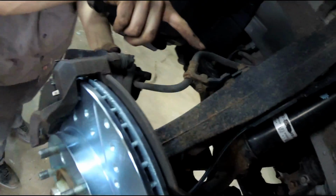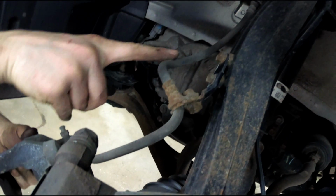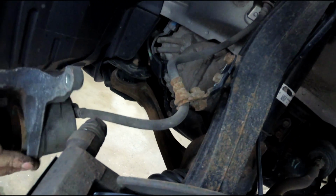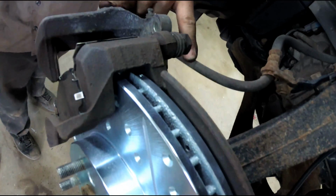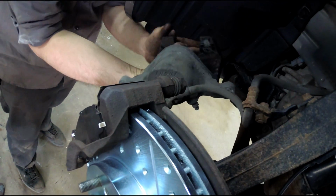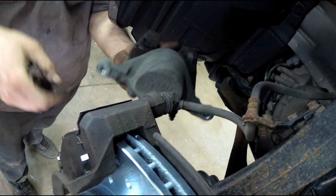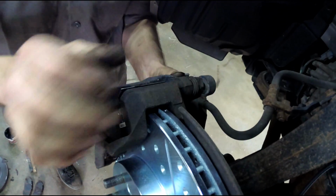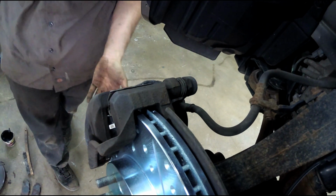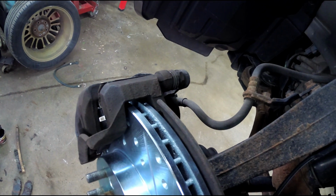If you want to note, on brake lines, there are lines going straight down the rubber line. That is so whenever you pull your caliper up, there's no twist. Some people don't take note, and if they do this, you can easily see there could be binding, and you'll notice that it's not a straight line. That's a good tip. I've seen a lot of customers come in, and they did their own brake job, and they don't know why their brakes are hanging up.